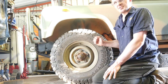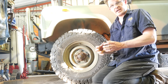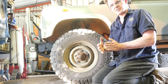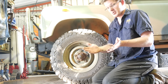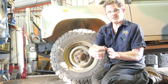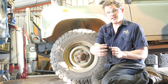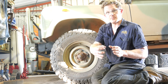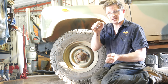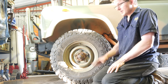The reason you check this particularly before a long trip is because the wheel bearings are tapered wheel bearings that slowly wear over time, meaning the preload actually changes. The preload is basically the force causing the wheel bearings to be pushed into the cone or race that they run on. Inside the hub there are two locking nuts that can come a little bit loose over time, and combined with bearing wear this causes excessive slop and can lead to premature bearing failure.